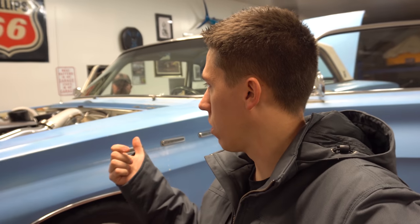So we ran into a few little things, but the car's running. If I set the minimum injector time on the injectors above 1.2 or below 1.2, the car wants to die. If I set it at 1.2 where the injectors are happy, the car wants to run really rich. So we're gonna pull some fuel out of the fuel pressure regulator to try to lean it out and see if that makes it happy. And then we can work on some other things.